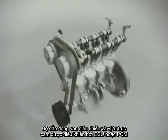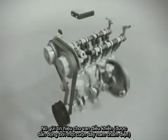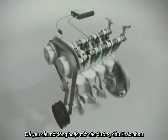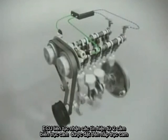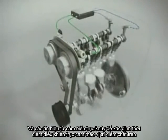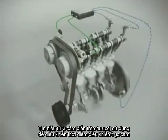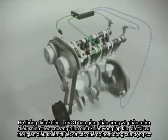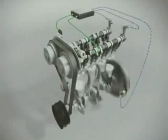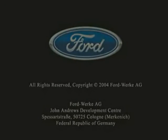The oil control valve actuation and the camshaft position are controlled by the powertrain control module, or PCM. It sends out signals to the oil control valve's magnetic solenoid driver to tell it to either open or close the different oil channels. The powertrain control module constantly receives information from two camshaft position sensors mounted on the valve cover, and from a crankshaft sensor, to determine the camshaft timing relative to engine top dead center. Data from all three sensors are used to control the camshaft timing. The TI-VCT control system applies closed loop control to ensure optimum cam timing under all engine operating conditions, and is able to change the cam timing in less than two tenths of a second from the most advanced to the most retarded position.